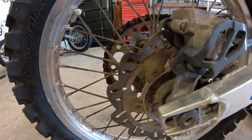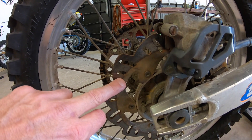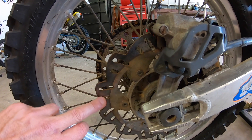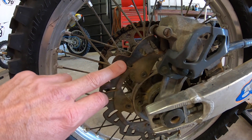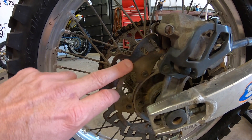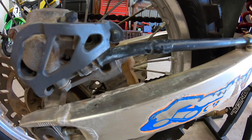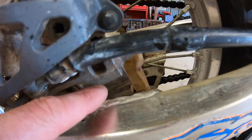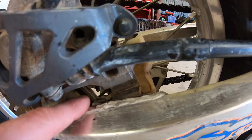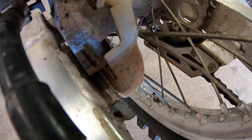When I took the bike for a test ride, the brakes were very bad even though they looked good. They had a lot of rust on the disc surface from sitting so long, and it took a couple of brake applications to rip the rust off and get them actually working. I also noticed the owner hadn't slid the brake caliper into the slide properly — it was sitting on top, which may have also contributed to the brake issues.